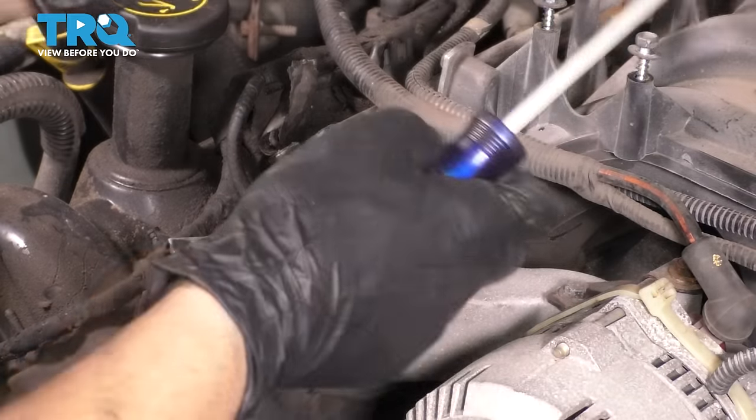You do want to seat it by hand. You don't want to just suck it in with the mounting bolts, because sometimes when you pull it in with the mounting bolts, it can actually rip that O-ring and you won't even know it until it doesn't seal anymore. So now let's start these bolts in by hand. We'll snug them up and torque them down. Oops, it popped out. So I guess I'll have to do that again, but at least if these are started, it'll slide in straight.